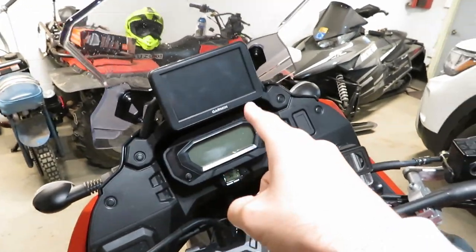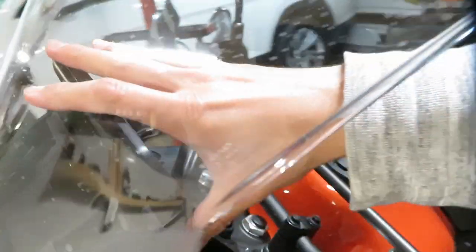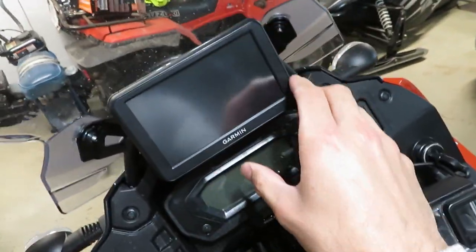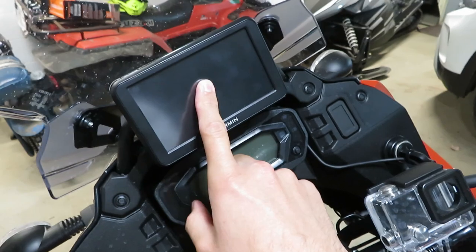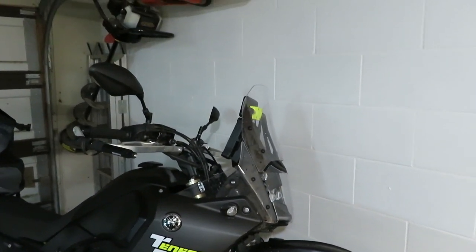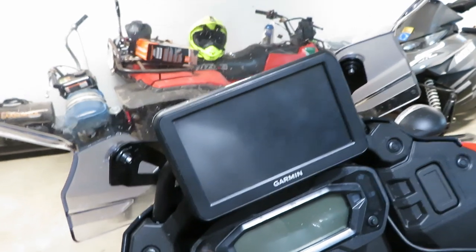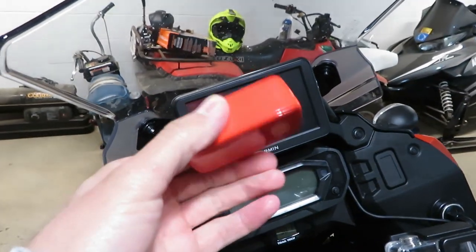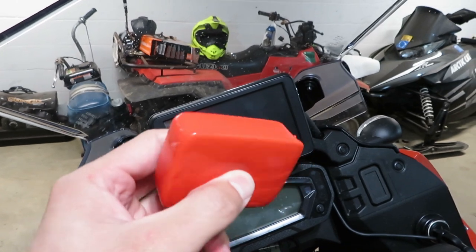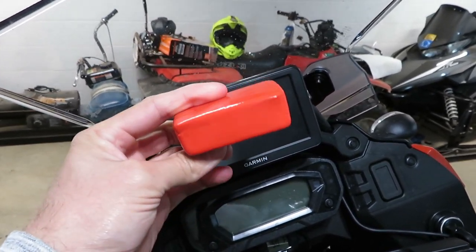I took this for a very short ride yesterday and it didn't take long before it was telling me it lost its power supply. Just by grabbing it while doing some investigating, going even like 30 miles an hour down the road, this thing has a really hard buzz to it. I took the Tenere 700 out right after just to compare — that one was almost completely still, like almost no vibration at all. So before I destroy this GPS, I'm gonna peel it back off and try something a little goofy. There's a Quad Lock product with a dampener but those are out of stock right now, so I've got this thing laying around — I don't even remember where it came from. My GPS is gonna stick out a little farther than I'd like, but I'll give it a shot.